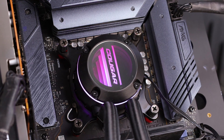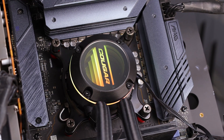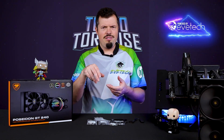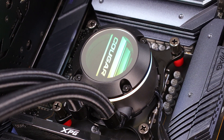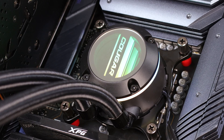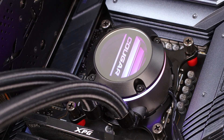The pump head itself is nice and sleek and pretty understated for the most part. As far as the fittings go, there are two changes I would like to make. These brackets employ an older style where they sit on top and then clip into position — except there's no real hard clip. They just have a little ramp that they twist into and then sit sort of loosely on top, which might be a little challenging for first-time installers. I really wish it clipped and locked into position. The silicon grommets that sit between your components and the motherboard are nice, preventing scratches and shorts — except they're bright red, which I don't know why. That should just be black to keep with the otherwise very clean presentation.